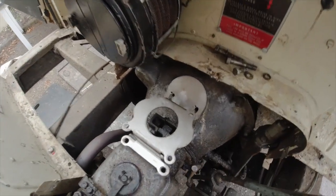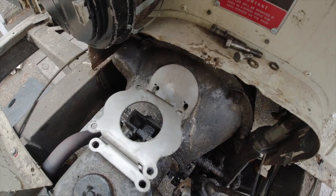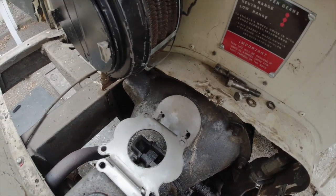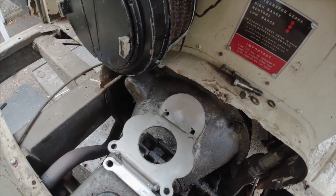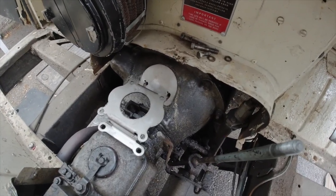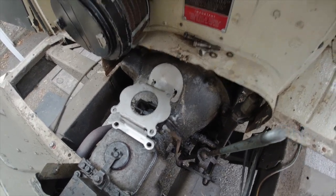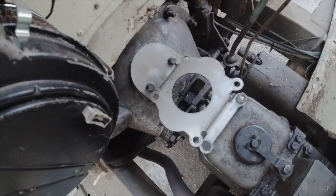Okay, so that panel, that sort of plate, doesn't fit. On the Tiersbeck they had to do it as well, but you can see I've had to grind away so that the holes line up. Now they're not even the same left and right, so presumably they were just drilled for this particular casing, and then tapped, so beware, this is not going to just pop on and fit. So that's the base plate in.